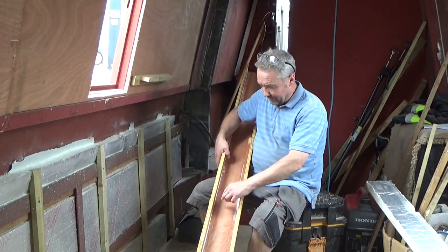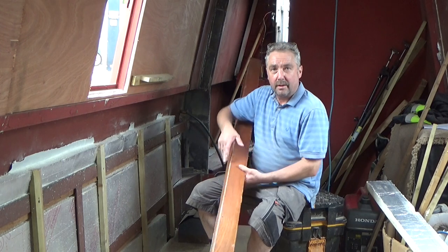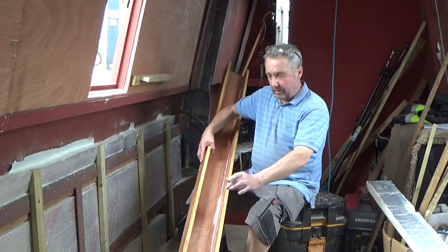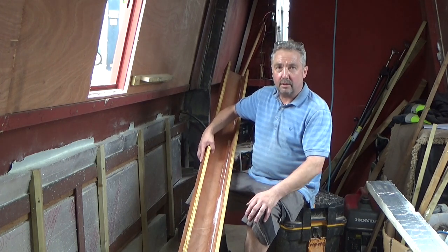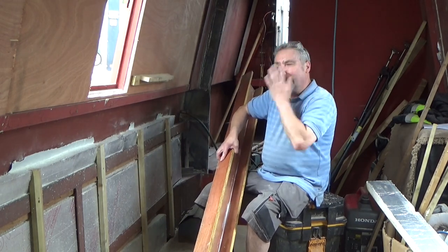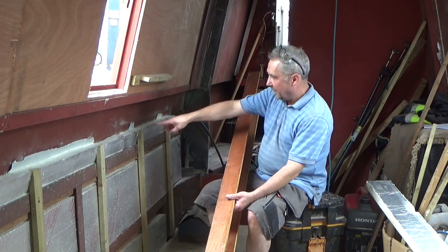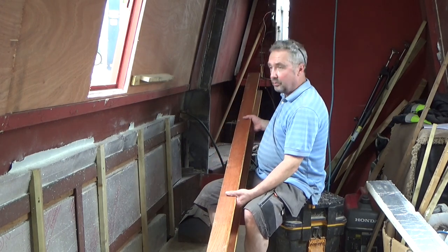Right, we'll have another go at that, because I made a mistake there. I glued these inside this, up to the edge, when they wanted to go on the top. And I want that distance about 100mm, so sockets can go on. Whatever I put there, the electrics will all go in there, so I wanted a decent gap there, certainly sockets, maybe some type of lighting, like gunnel lighting along there, I don't know. So I'll just cut that down again, like 40mm to compensate for that thickness. So this should just sit in.